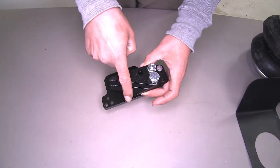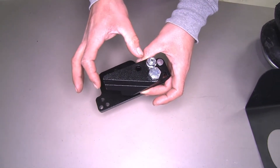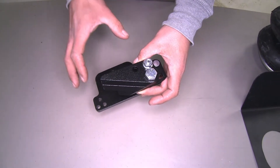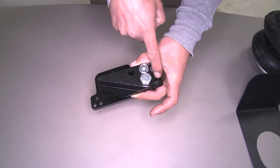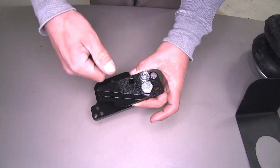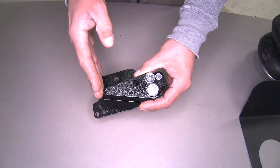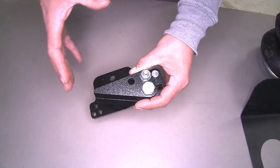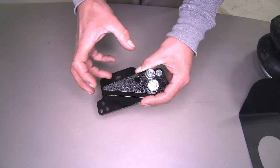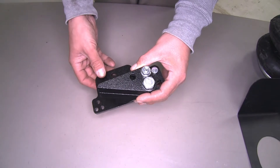Our overload pad is going to work a lot differently. You'll notice it's got this wedge right here — this is actually going to go in between our overload spring and our leaf spring to activate the overloads right off the bat. This particular one has a square hole so you can take a ratchet and an extension and apply them directly against the overload spring. So we're not going to have to wait until our leaf springs flex all the way down; it's going to apply those overload springs right away.